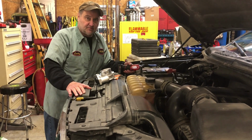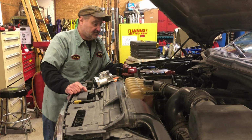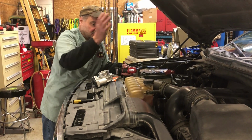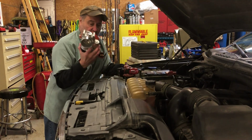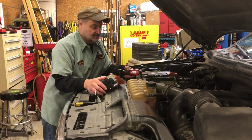It's not a Lariat, I'm told, but it has 496,000 miles on it. The latest code's been throttle body related. The idle's been hunting around, running rough. Sometimes it's okay. We're going to change the whole throttle body unit. We've got an aftermarket one here. It's probably just the motor, but we're going to change it.